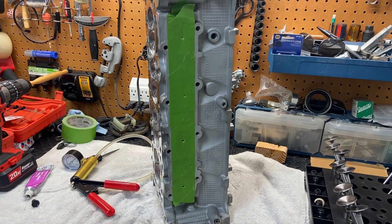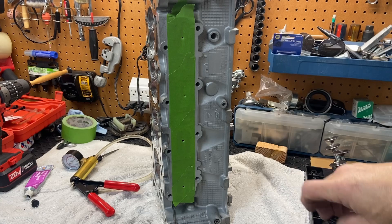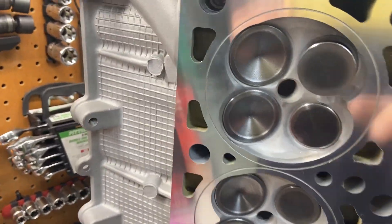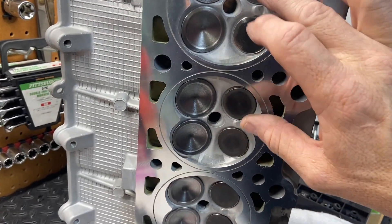I think we're pretty much done. We're currently waiting for valve stem seals to come in. As soon as I get the new valve stem seals, we'll go ahead and put the springs and everything back in. Then we can start reassembling the cams, timing gears, and get this back together. Once you're done with this, be sure to pull all the valves out and make sure you have all the grinding compound out — you don't want any left in there whatsoever.